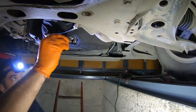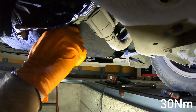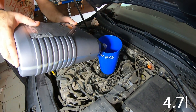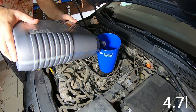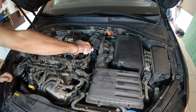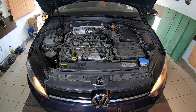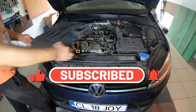Re-insert the oil drain plug and tighten it to a torque of 30 Nm. For this engine the oil capacity is 4.7L. We recommend initially adding 4.5L and then adjusting based on the dipstick reading — it should always be between the minimum and the maximum levels. Now you can replace the oil filler cap and start the engine. Don't forget to replace the engine cover and, most importantly, give this tutorial a like and subscribe to the channel. Goodbye.